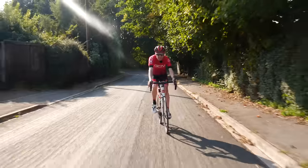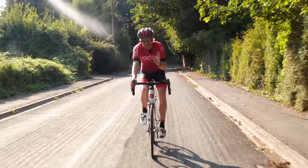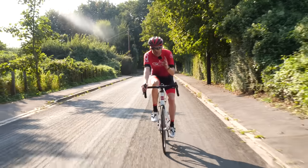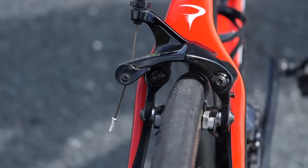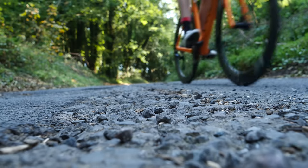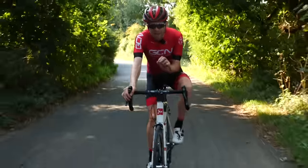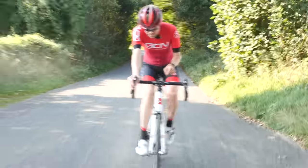But if we talk about rim brakes, then the modern 105 has improved there as well. The current caliper design is exactly the same shape and design as the modern Dura-Ace caliper. It's just made from slightly less expensive and heavier materials. But this modern design is said to be stiffer, and that translates into better braking performance. It's also a bit of a neater design, and the cam lever is kept out of the wind, which Shimano reckons makes it a teensy-weensy bit more aerodynamic than this one.